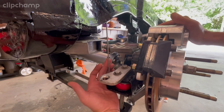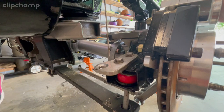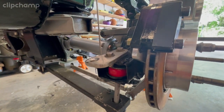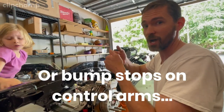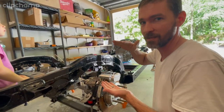Naturally, without this cable, the suspension wants to drop another like two inches, and then you're deep into the bind situation. Most cars from the factory have a natural limiter being the shock — when the shock is fully extended, it is what stops the suspension from extending any further.